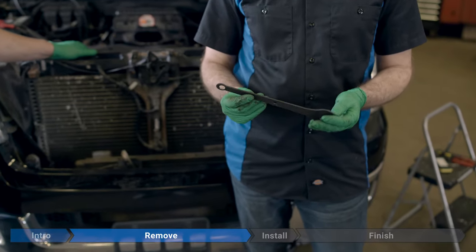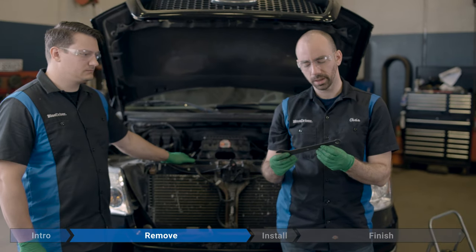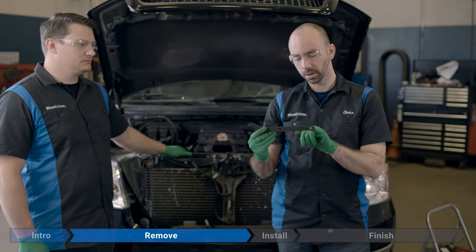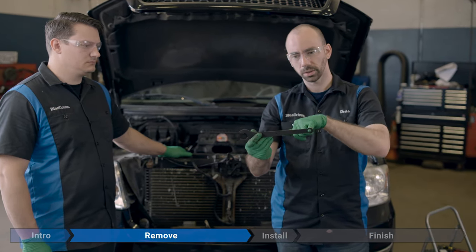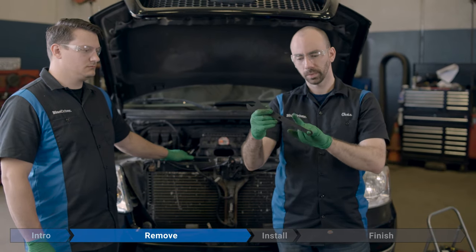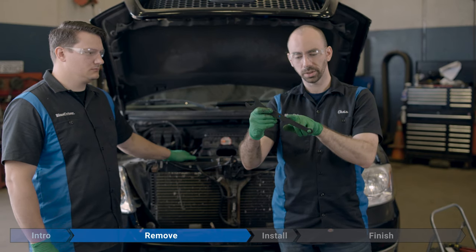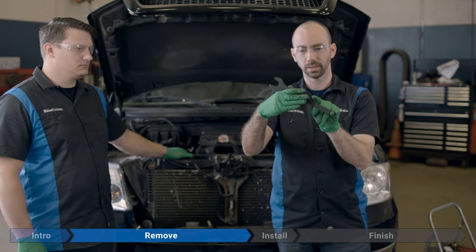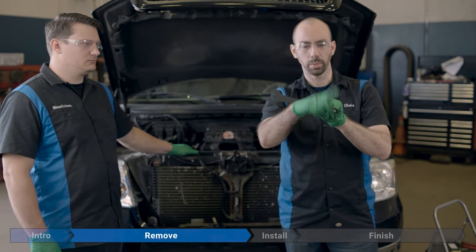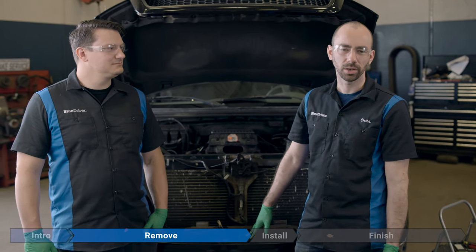This is just an old wrench from the garage — probably for bicycles — with a hole drilled in the end, just big enough to fit over one of the four bolts on the water pump pulley. We're going to put this over one of the bolts on the bottom, with another bolt nearby. When we try to break the torque, the pulley will want to turn, so we wedge this end of the wrench on the belt tensioner to hold everything steady. For that 36mm nut on the fan clutch — that's supposed to be another Ford special tool, but we can make do without it.